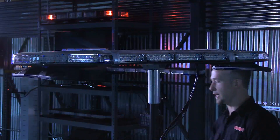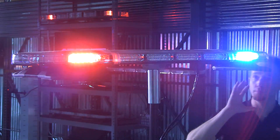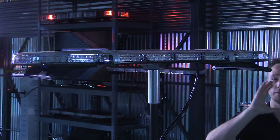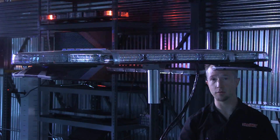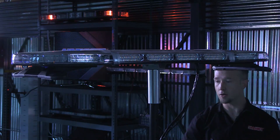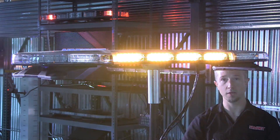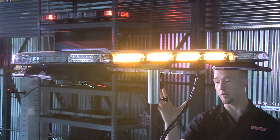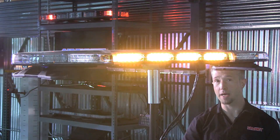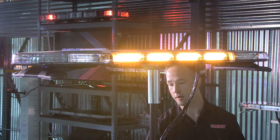On the rear of the light bar, switching it over to just a simple display — main focal color is amber with red and blue on the outside. Through the software, the flash pattern has been adjusted to my choosing. The low power button obviously takes that and tones it down. The photocell that you can add into the light bar will take care of that automatically by reading the ambient light, so you won't have to rely on an on-off switch.